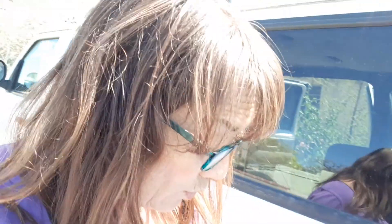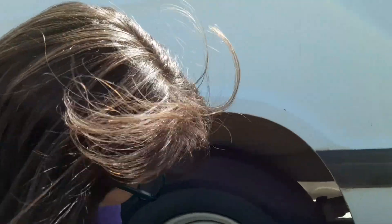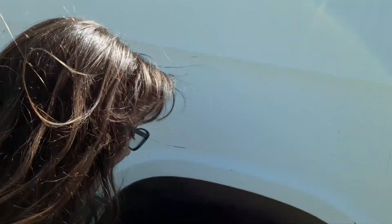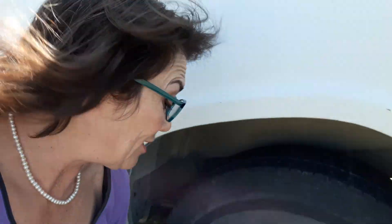Once you get those loosened up, you always go in a star pattern. It's less important when removing a flat, but on the way back it's really important to put them on in a star pattern — going across from one to the opposite, back and forth — so you don't end up with a weird torque in your tire. Even more important when putting it on, but it's good practice always. This van has eight lug nuts, which is quite an elaborate star pattern, but you don't have to be exact — just go relatively across.